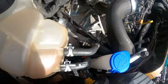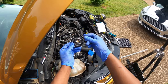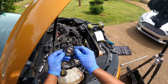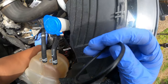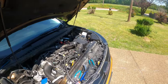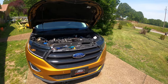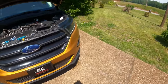I can't get a great angle, so I'll show you guys exactly how it's going to go in. The vent is going to go at a 12 o'clock position, and the O-ring is going to go on top. Let's go ahead and put this thermostat in. Shout out to BNS Automotive Mobile — they came and redid the threads for my Edge, fantastic. Colin and his father helped me out because I was freaking out about this, but no need to worry. Next we need to go underneath and tighten up the drain plug.